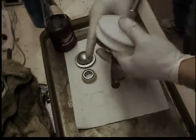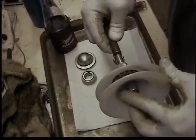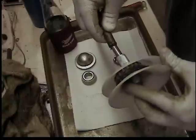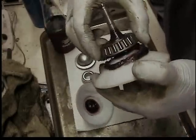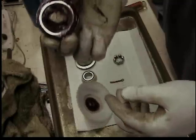You hook that up to your grease gun and pump some grease in until it oozes out of the bearing - so now you're getting it all inside that bearing cage, all around every needle bearing. Take it out of the packer and just rub a little of that excess grease on the outside, and that bearing is ready to go back in.